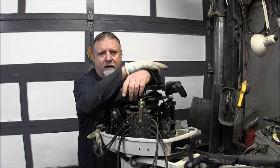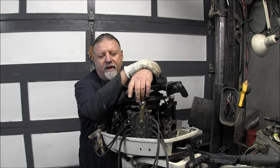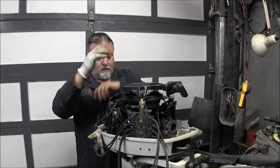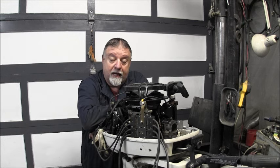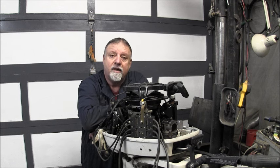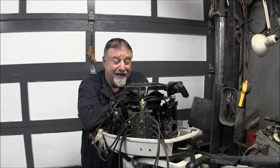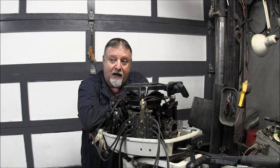Okay, I went out in my parts room there, and if I dug around for a good while, I'm sure I could find a used one out there. But why am I going this route? CDI says for this particular motor, this setup, if you lose spark on both cylinders, suspect pack. If you lose spark on a single cylinder, suspect coil. And I have found through experience that most often that is true. If you follow that chronological order at the CDI website, I don't have to light off my Stevens ST75 over there and stuff. I generally find that is the order to test these in.